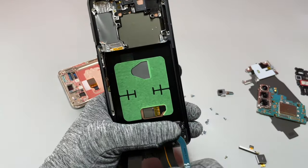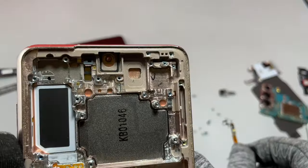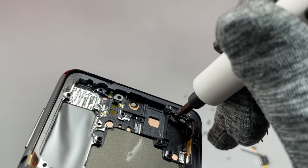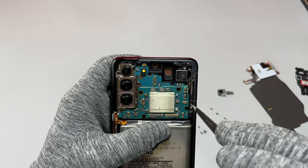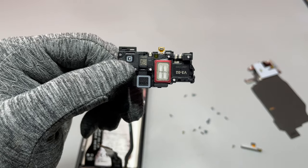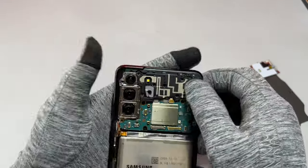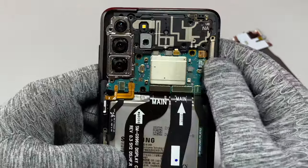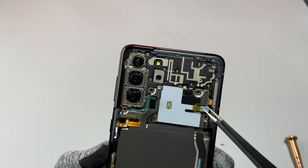Let me explain what I think was happening. The power button being stuck — and maybe a volume button too — meant the screen was not responding. I believe the device went into safe mode. In some weird situations with certain apps, the device can be completely unresponsive and the power button won't respond until you enter bootloader mode. Bootloader mode lets you send commands directly to the device without going into One UI. That's the beginning of heavy troubleshooting on an Android device, provided you have working power and volume buttons.